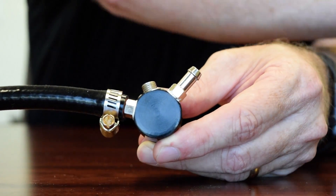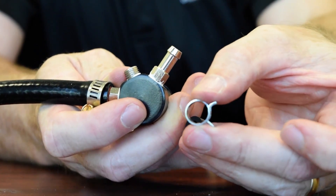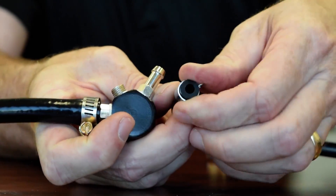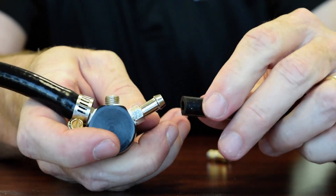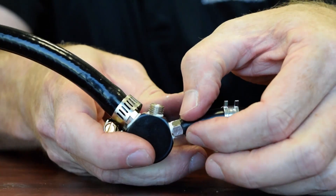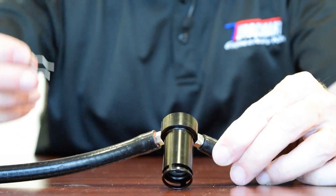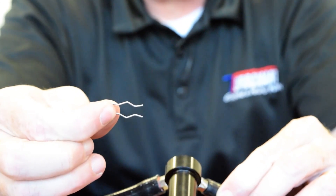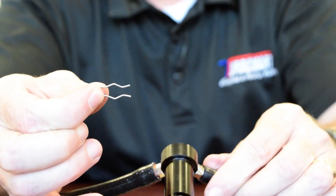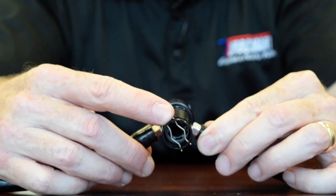Next, take the vacuum hose and one of the included spring clamps, slide that right over the barb, and install it on the opposite barb. Take your pliers, move the spring clamp over, and tighten with a screwdriver once you get it on the engine. Please remember this very important spring clamp is included in the package and very easy to drop or lose — it is a critical component which goes onto the boost reference adapter, allowing it to stay onto the manifold.